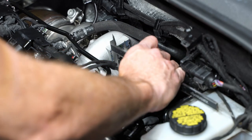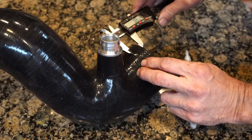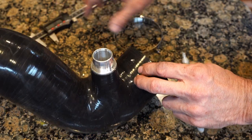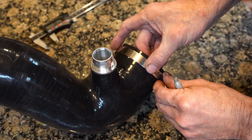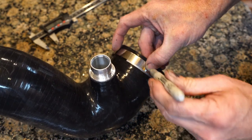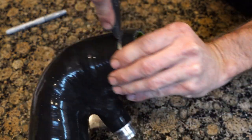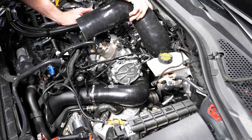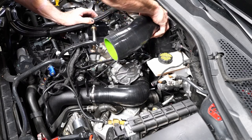This is the intake pipe that came with the turbo. I need to make it a little bit shorter because it's a little too long - it sort of interferes with my brake master cylinder. I've measured out how much I can safely cut off without compromising the seal of the pipe to the turbo itself, and I cut it down a little bit shorter so I could get it fit in there without any clearance issues. It's a little more challenging to work with the silicone inlet than, say, an elbow and then an intake pipe, but it goes on.